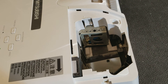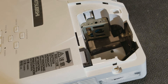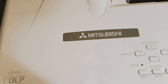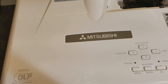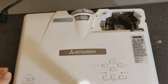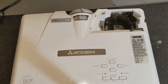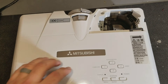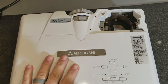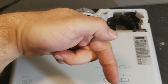Take the Q-tip out — that will shut the projector back down. I'm going to unplug it and put the lamp back in and put it all back together to get it back to the customer. But you get the idea. If you have any questions about checking your color wheel — again, only for DLP projectors, these are not used in LCD — troubleshooting an LCD projector for a lamp not starting is a totally different process. This would confirm that either the lamp was a problem or that the ballast or controls were a problem. Usually when the color wheel spins up and the fans come on, my first suspect is the lamp. Then we move to everything else. If you have any questions, leave them below.